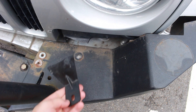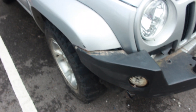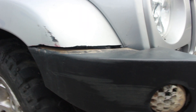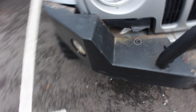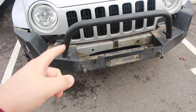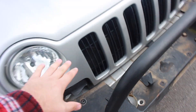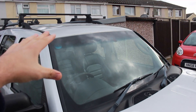After breaking off the plastic connectors we didn't really need, the front support is now fitted on pretty firmly. We've got the plates on at the bottom and the bolts are through. We had to make some adjustments in the wheel arches - cutting off the edges so the front support could fit in far enough to bolt in. Both sides fit on pretty well now. The next modifications coming up are fitting a winch to the front, blacking out the grille and arches to match the front brace, and getting some aftermarket roof lights across the front.